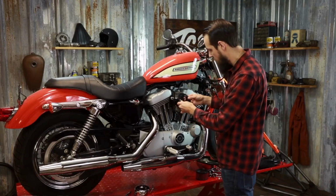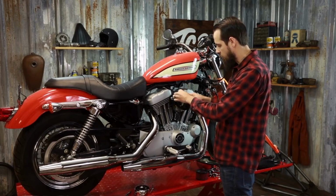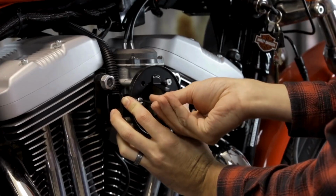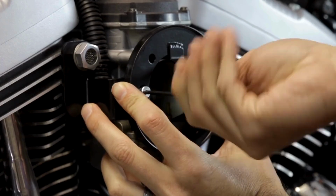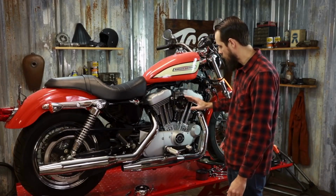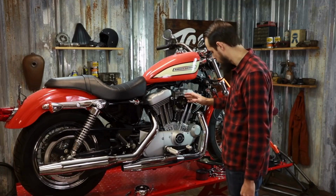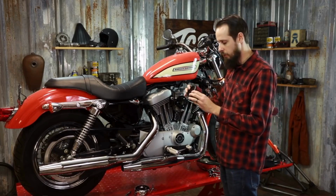You can use the same type of technique as you did to get the bracket gasket lined up by placing the screws through the holes in the gasket. Now these tighten with a hex Allen wrench as well. And don't forget your thread locker here either. Now that the base of the air cleaner assembly has been tightened securely to the carburetor or the throttle body on your fuel injected models, you can install the high flow air cleaner unit.